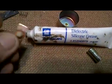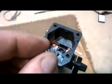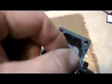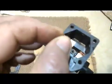You might find you don't like that, but I have found it to be worthwhile. That little spring is a return spring so that the contact doesn't stay on accidentally once disengaged. And here's the actual contacting mechanism to allow the full 12 volts to go through to the starter.